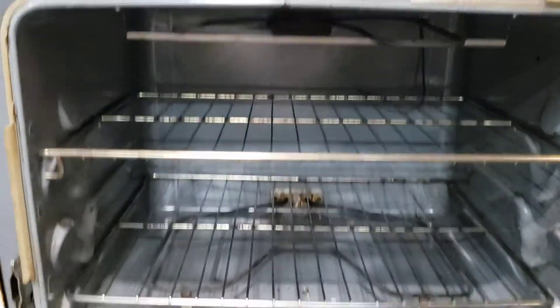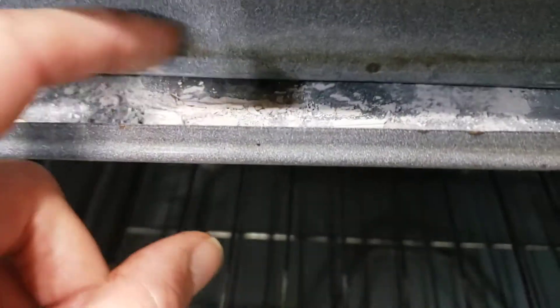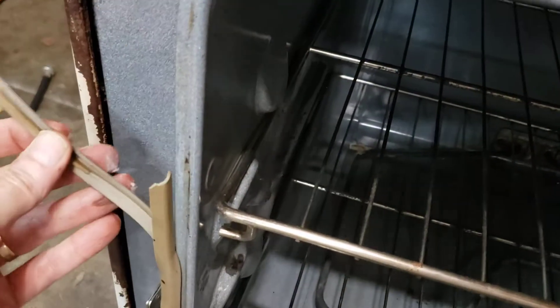To make my life easier, I pulled the oven door off — they just lift straight up off the hinges. And you can see how that old gasket is just cooked, as hard as a rock. We need to get all that out of the way.